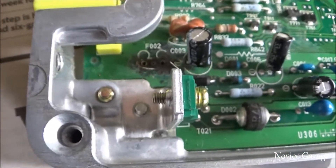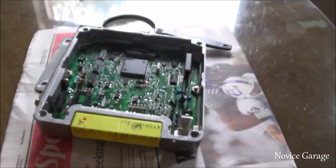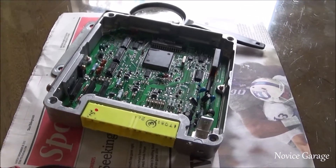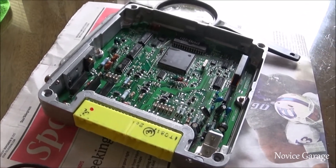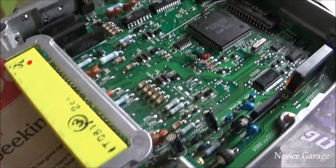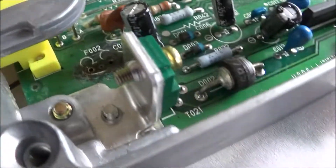I'm gonna try to repair this board, but if I can't I'll find another used ECU for about a hundred bucks. It looks like there's wire damage — about two months ago I left my rear window unzipped during a rainstorm and came back to about two inches of water in the floorboard. On the 94 Miata the ECU sits on the passenger side wall behind the seat, so the rain was going right over it and got in there — you can see some light water damage.